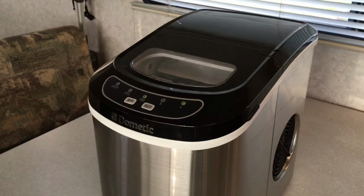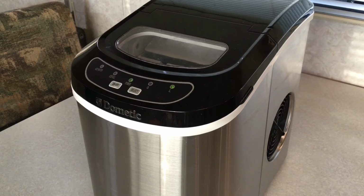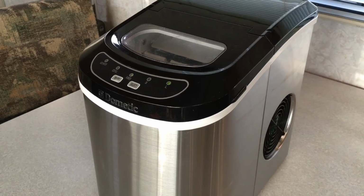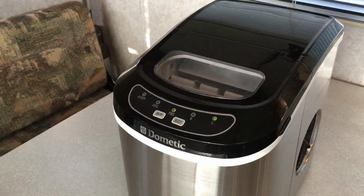And this sure does beat having to just toss the unit out. A lot of folks are replacing the pumps, and you know, it might have just been restricted like this one was. If it wasn't for that hair, it could have been that piece of plastic from the shipping from the factory as well. So many things are possible to restrict that flow. But it's always good to just take a peek and see what the cause is. So let's hear that first batch of ice, and we'll be back on our way and won't have to worry about this problem for a while.